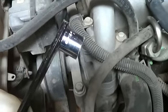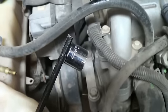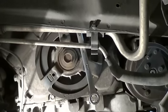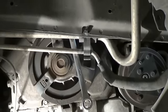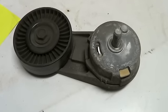The bolt for that tensioner is in there real tight and you don't have a lot of clearance in front of it. That's why this serpentine belt installation tool comes in pretty handy — you can sneak in there with this and get that loose. If you don't have the serpentine belt tool, you can get to it from below. We've got a 15mm boxed-in wrench on there right now taking that bolt out. Took a lot of turns but I finally got it off.